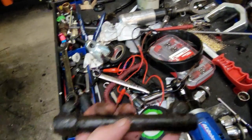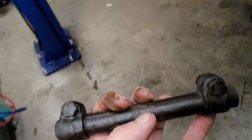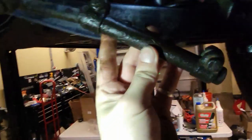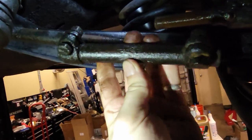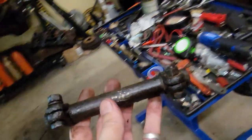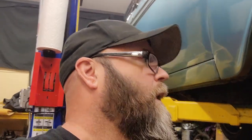That's where we're at — trying to figure out how to get this thing to go straight so I can take it for a spin. Dying to get it out of here. So for those who don't know, the sleeve goes here — see how much longer it is. If I bottom this out on the threads, see how much past the threads it is — it was bottomed out. It's too long. I know some of you are saying just go get a shorter one — the problem is when you look up for a '56 Chevy it's gonna show you this one. I spent maybe an hour online trying to find specs: what thread size, what thread pitch, what bolt size.